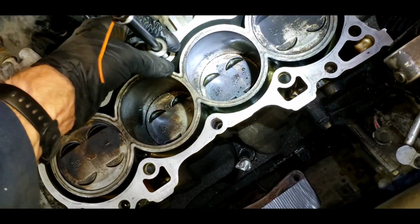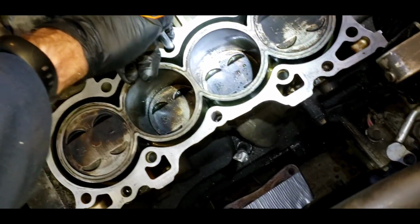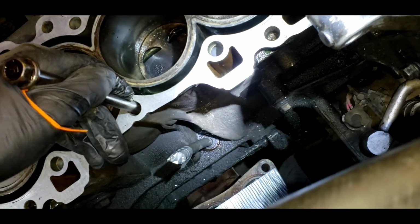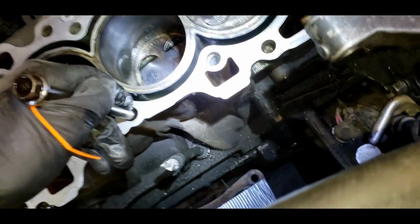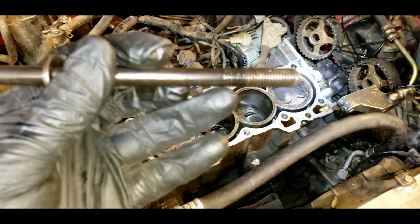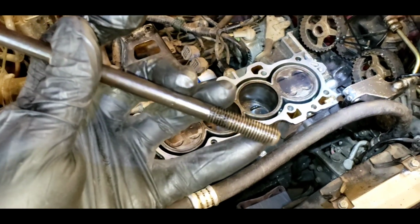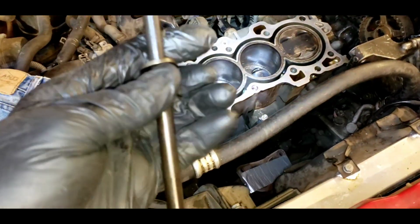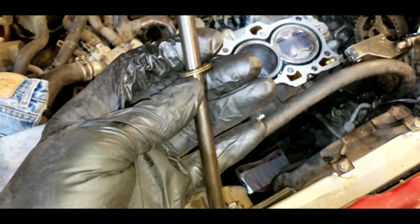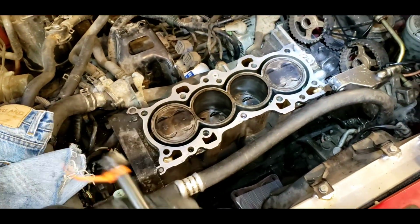So if I put that bolt in the hole, I'll put my finger right there where it's decked with the block, and I'll pull it out and see where my threads are here. So I've got about 3/8, maybe even a 1/2 inch where my Time-Sert is a little higher. I just couldn't get it down because the tap wouldn't go any further. But you can see on the threads, there's another inch or so of threads that aren't being used. So that means that this will go further into the hole. It won't grip down here on the very tip, but it'll grip more here on the shank. I think it's going to be okay. I suppose I could put another washer on, but I don't think I want to do that. I'm going to see how it torques and pay very close attention to how this middle one torques up. So let's put the head on.